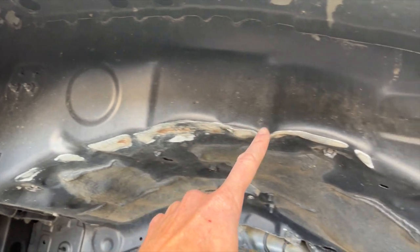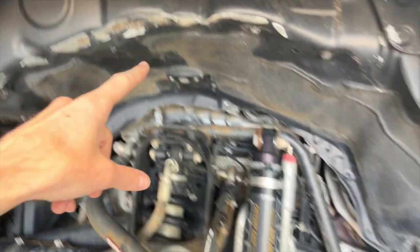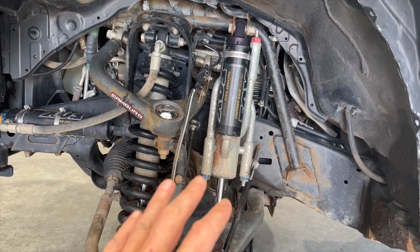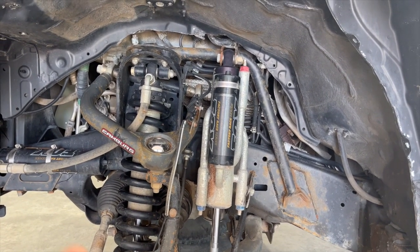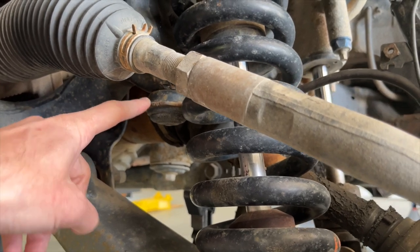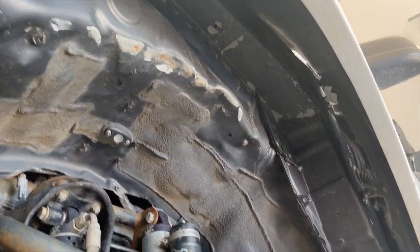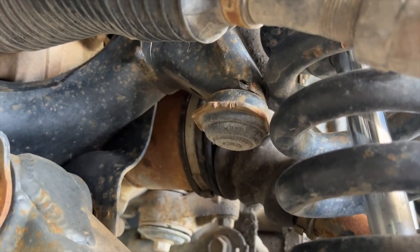You'll notice some rub marks up here — that's where I've actually been able to get my tire all the way up to touch. It doesn't happen very often. When it does, it's usually because I'm running my triple bypass super soft for normal basic trails and then get into some heavy stuff without climbing out and adjusting the shock. There are two ways to solve it: always get out and adjust your shock before you go into heavy stuff, or do a little work on the factory bump stop — take it off, put in a longer one, and dial it to give you the exact amount of movement to protect up there.